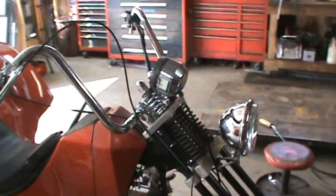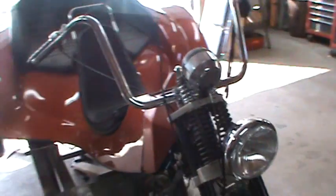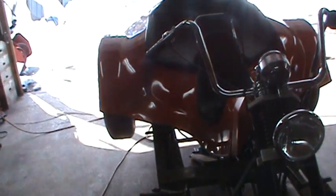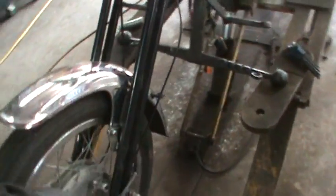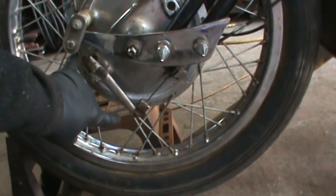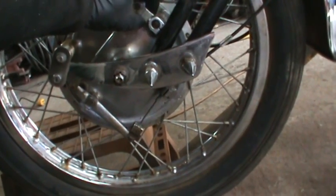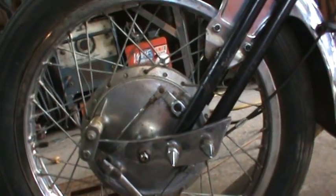The cable is kind of long. There's really no good, the cables always look ugly. I don't know any other way around. Speedo cables and clutch cables and throttle cables, the way they come out doesn't always follow a handlebar, so you can't really kind of tack them down to the handlebar. That one's got some length to it, kind of zigzags across and then comes down, and will mount at the correct location, so it actually will work okay. I pulled the brake arm off and clicked it one more degree, and it gave me the right throw for it. I can't get the top one back on yet because the fork's in the way, but again, the whole thing's got to come apart, so I'm not that concerned about that.